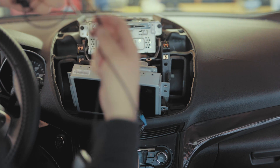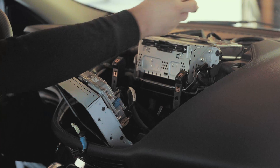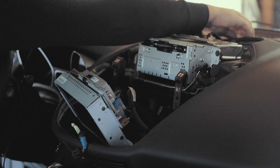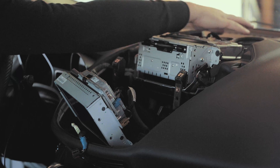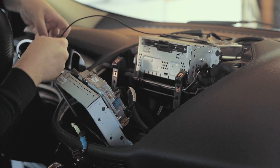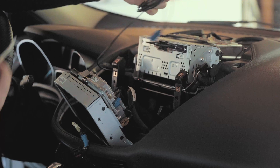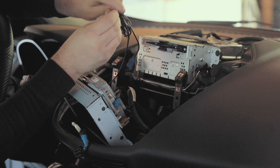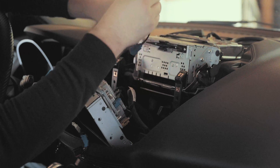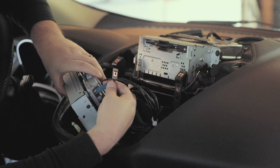Taking the side from the GPS itself, get a couple rounds of that right there — just enough so we can fit it back here. We're going to put it right into place back here, right next to the left — the driver's side — of the center speaker. We're going to route the cable back up this way. Now we're just going to take the excess and zip tie it all off. And we're going to tuck all of the excess back behind here and plug in to the APIM.